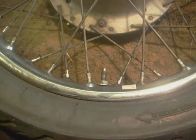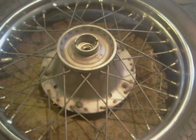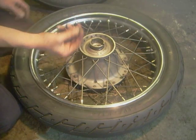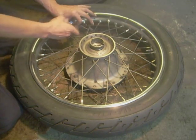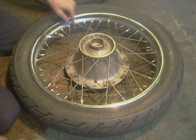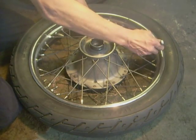See if it fits when I've got it on the wheel. I have two tire grips — there's one there. There's my valve. The first thing I'll do is let the tire down and then try to crack the wheel off the rim. This tire hasn't been off for about a year. Let the tire down — my valve caps have a thing on so I can undo the valve. Take the valve out somewhere safe. 12mm spanner to undo the lock nuts and the same on the tire grips.